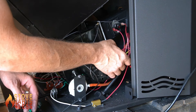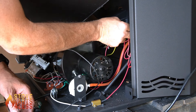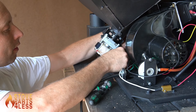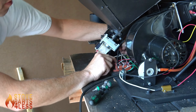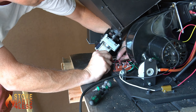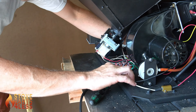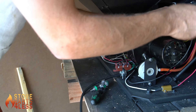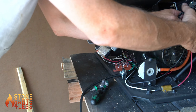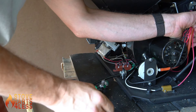One black wire goes up to the fan switch that turns the blower on — make sure the yellow wire is also attached to the other side of the fan switch. The other black wire comes underneath the auger motor and attaches on the common bus; any available connection there can be used. Make sure the wires are free and clear of anything in the back of the stove, zip tie them back up, and we're done.